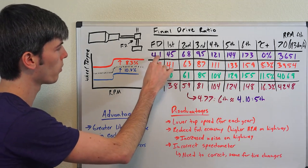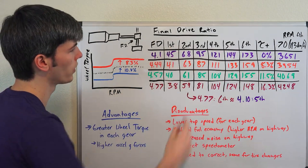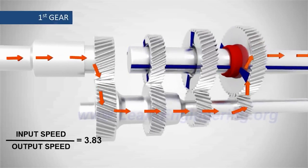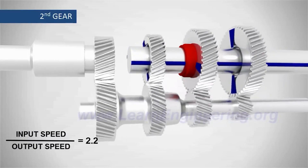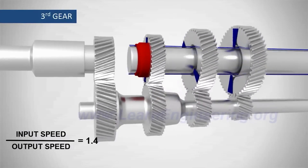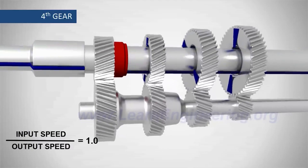To move back a little bit, the whole point of having a gearbox — of having different sets of gears at different ratios — is all about torque multiplication. Being able to operate at different speeds in different gears allows you to, for example, have first gear as a relatively high torque multiplication because you have to overcome gravity and friction to get the car moving. Whereas when you get into higher speeds you don't necessarily need that; once you get into fourth or fifth gear that's typically when we start to see one-to-one ratios. You don't need the multiplication of torque — you're actually looking for speed.